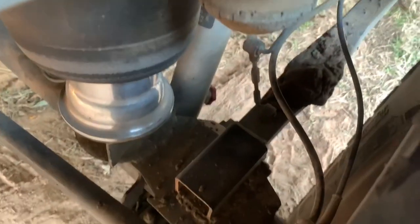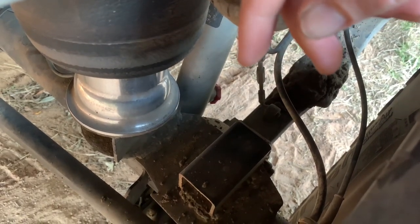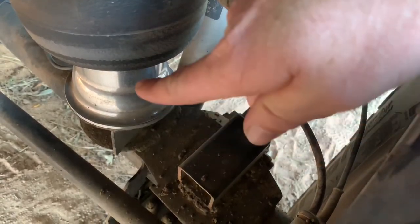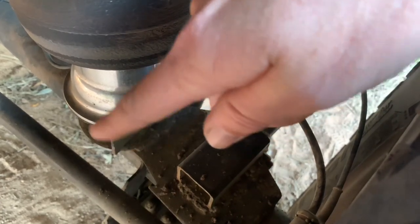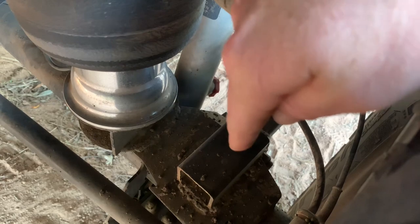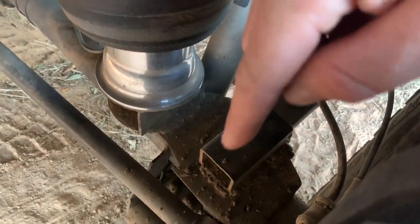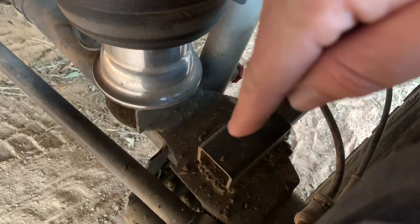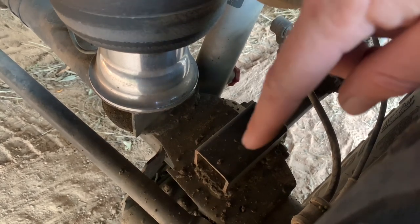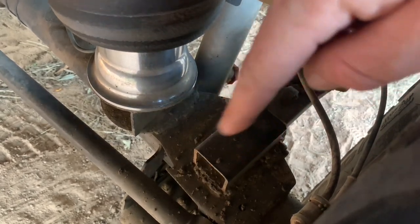You need to remember with your bump stops on the front, you won't be able to weld a block like that there on the front, because if you've removed an air spring from the front of a P38, you'll know that you need to get that little pin to go sideways to retain the bag. And I've also got my spacers retained using that pin. So you'll need to make sure that you can either take your front bump stop spacer out somehow, whether you use a different bump stop or whatever you decide to do. What I've used is rubber blocks in the front. I've drilled a hole straight through it and into the diff, and I've bolted that 50 mil rubber block down. So the spacers are identical, except for the fact that it's a one height. And I've used a 50 mil rubber block instead of the RHS box section, whatever you want to call it.